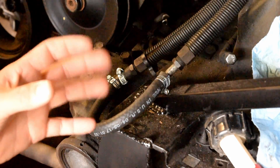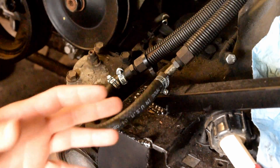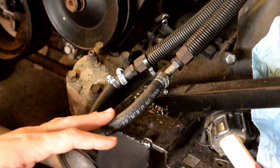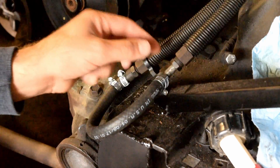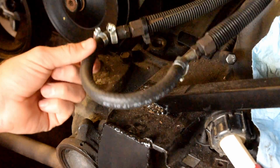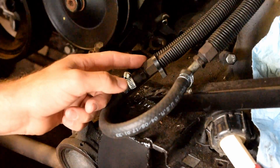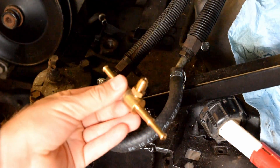It also comes with some hose clamps and leads for the multimeter. As you can see in my other videos, my car is gutted — everything was taken out. But if you're testing your fuel system, yours may not be. I'm testing it right here where the lines come into the engine bay. This line is the feed line and this is the return line.